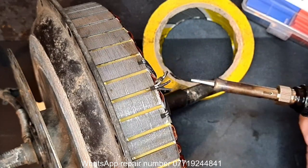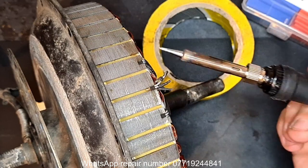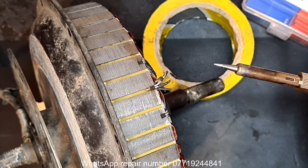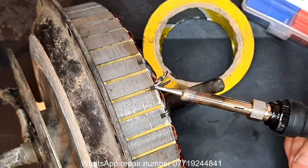Unlike the other two sensors, when you rotate the motor, the signal goes from 0 volts from the last leg to 4.8 volts, roughly, give or take. But the point is, it turns on and off every time there's a rotation past the magnet. So we've cut our three legs, we've got to remove this.